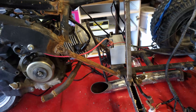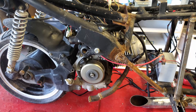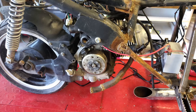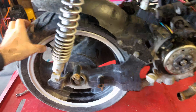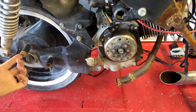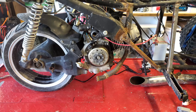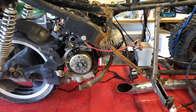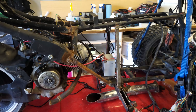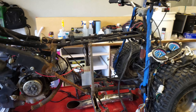I did get it running — I'll go ahead and start it up for you. She's running but it's not pretty. Next I'm going to change out this swing arm, and I've got to change a tire and wheel because it's flat and doesn't hold any air. The exhaust mounts were cut off, so I have the exhaust off that Chinese scooter I tore apart which I'll put on there. Then I'll put the cooling covers on the engine and start cleaning up the wiring, and then I've really got to work on the frame — this thing's pretty hideous. I'm going to pick up a welder and try to clean it up, grind stuff down, and make it look a little bit better.